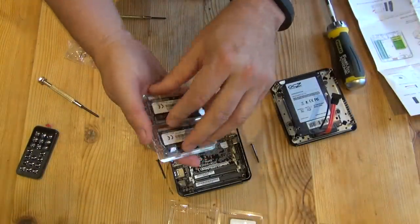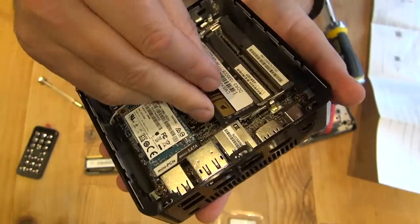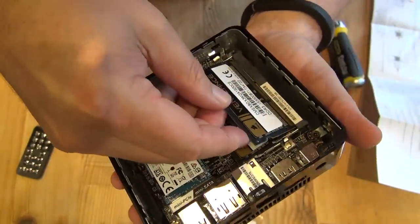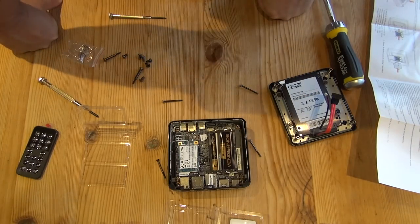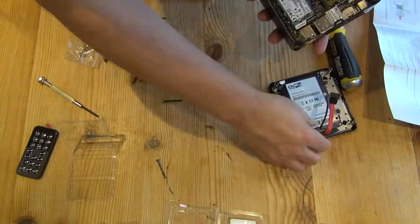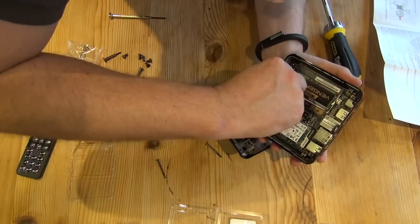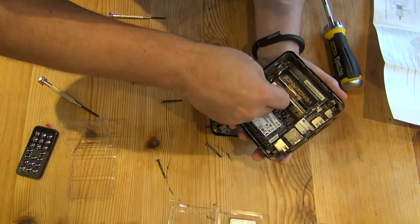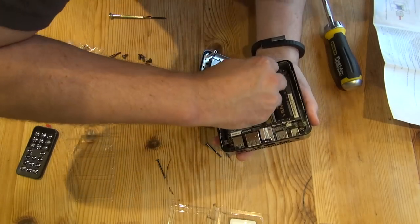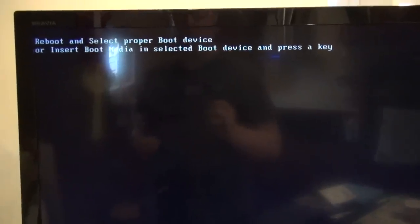The next job is to fit the RAM sticks. There are good instructions in the pamphlet that comes with the device. One thing I would say: one of the modules was not properly seated the first time around, so I did have to go back into the case and double-check. But they do click soundly into place, so you shouldn't have too much trouble. Before you close up the case, you have to connect up the very short little cable onto the two slots on the tiny motherboard, and this is quite fiddly, particularly if you don't have particularly good eyesight. Once the case is closed, it's very difficult to see what's happening with the cable, and my cable was actually damaged as a result of case closure, and I know a number of other people have encountered the same problem.